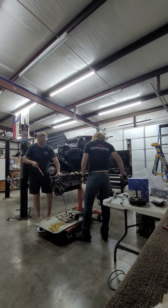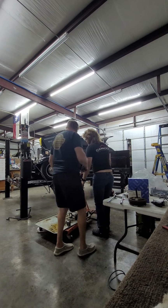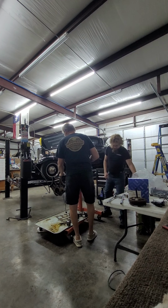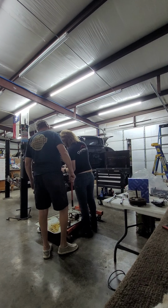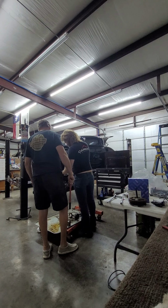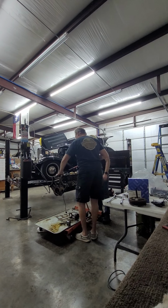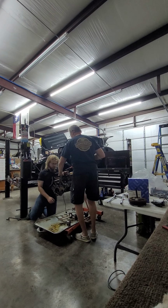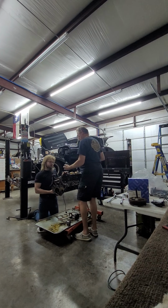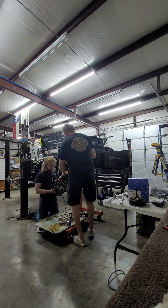This motor that we're taking apart is so clean. The bearings are so fresh. They look brand new. You could put it back together just like it is, with new bearings, of course. Don't they torque down though? Isn't there like a torque issue? Bearings don't get crushed under torque. Under load they do, but not under torque. If you notice they still move when you take them off. So these ones aren't even crushed down enough to worry about it? I don't see any problem.